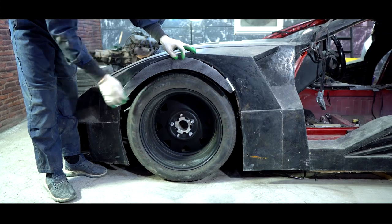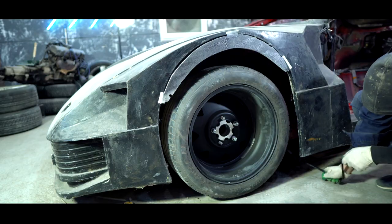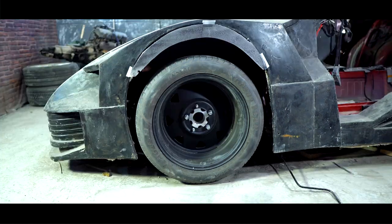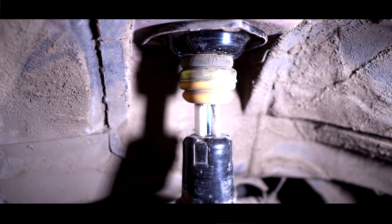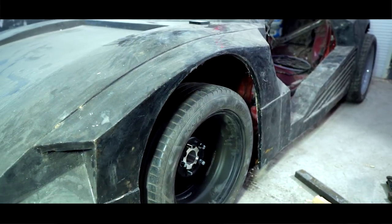As a result, we'd get 10 cm of clearance. If we lift the bumper a little, there will be 13 to 14 cm, which is already good, but I still want to leave everything as it is. I am inclined to the air suspension and adjustable altitude depending on the situation. For now, I put the plastic hobs instead of springs on the shock absorber rod to try to drive a bit along the workshop in such a setup.